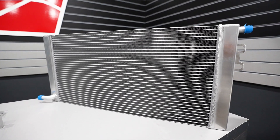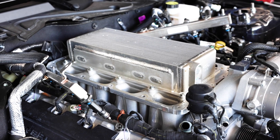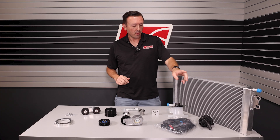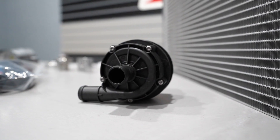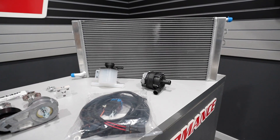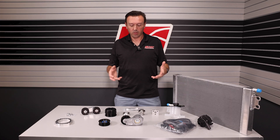Next thing, you're going to need a heat exchanger. The Predator supercharger system has an air-to-water intercooler in the lid. It is an inverted style supercharger — the air discharges up and the heat has to be carried away with a pump and dissipated with a heat exchanger. So we give you our latest greatest high flow pump, wiring harness for that pump, reservoir, and our heat exchanger. This is a no-fan entry level unit. We also have fanned units, but that's going to require an à la carte build out of these components.